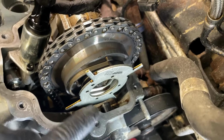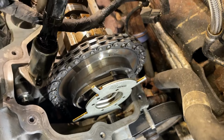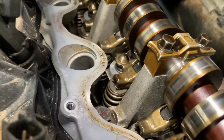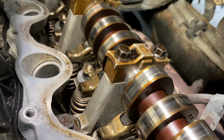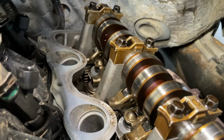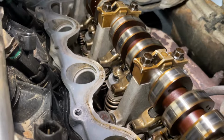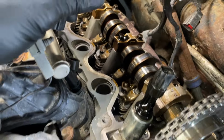And of course, Dorman phasers over here. And it looks like they are lined up okay. An aftermarket chain on there. Reused the roller followers for some reason. And it looks like this side might have a new head. You can see the head is clean like new, but they transferred the caps over. You see that difference in color, the varnish on there? This is just a real hack job. Man, I should stop right now on this one because it's not looking good.